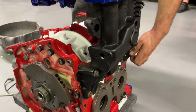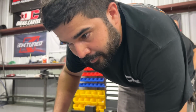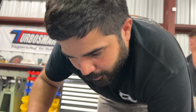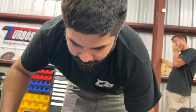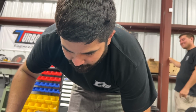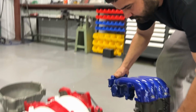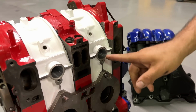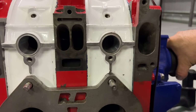So this is the semi-peripheral intake here for more horsepower. Street port, there's bridge port, and then there's like semi-peripheral. So this one's a semi. And that's the best to have? Yeah, because it cools the apex seals. So these got machined to be intake ports now. If you look in there, you can actually see the rotors in there.